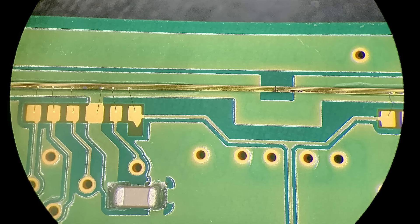Each strip of silicon with all of those pixels — you can't make one that's eight and a half inches long. So you're going to make a bunch of little ones and stack them together. Where I have it marked as a V here, you can see that there are two pieces of silicon butted up next to each other, and you can just see the little break between one section and another section.